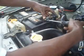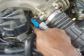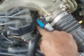We are at the end of our installation and I will reconnect the positive terminal for the battery so we can start the engine. You will fill the radiator up from any coolant that you lost on the hose that was disconnected by the firewall, and you will fill up the coolant reservoir to the max level. Don't forget to connect the vacuum line at the back of the engine — that vacuum line will be on the tube that is bolted to the valve cover.